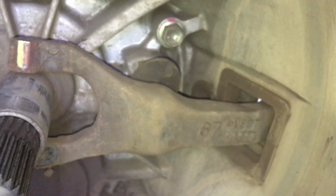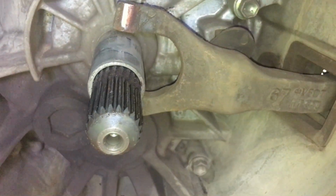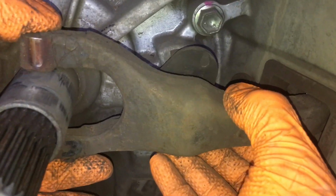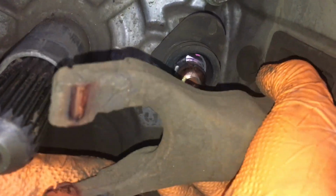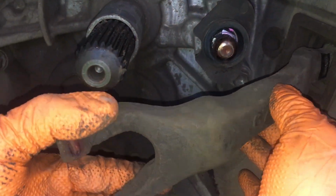So let's pull that fork off as well. Let's ditch that bearing. Chuck it in the bell housing, whatever. And let's see if we can pop this clutch fork out. It's like a ball arrangement there, and it can wear as well. It needs to be lubed, so if you give it a wiggle and pull, I reckon even you'll be able to get that off. That's it. Nice. So it's got a little bit of grease there. Let's turn it around and have a bit of a look.